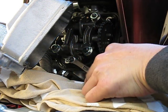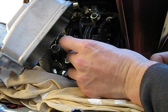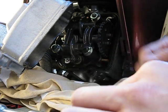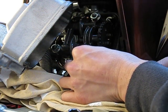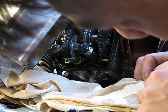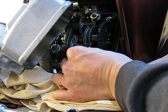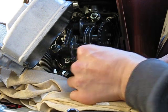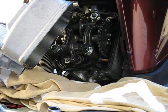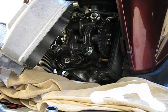Hopefully this will be the last one. The twelve thousandths feels pretty tight now but I'm not quite happy with the ten thousandths feel. Basically just keep going at it until it feels right — you want a really light drag on the feeler gauge, then button it up.